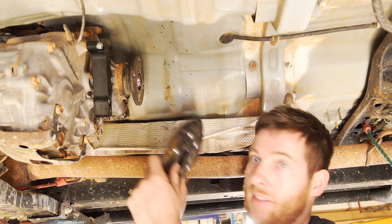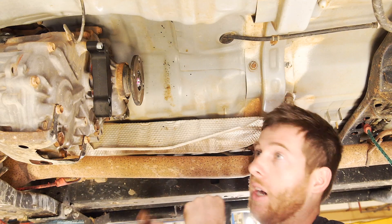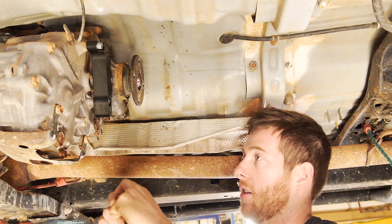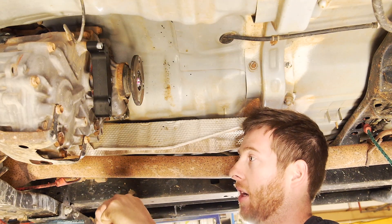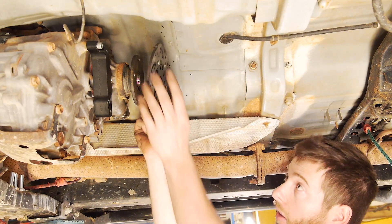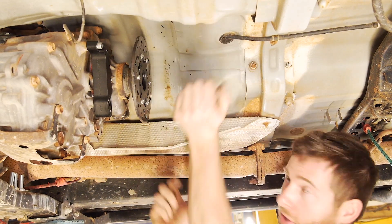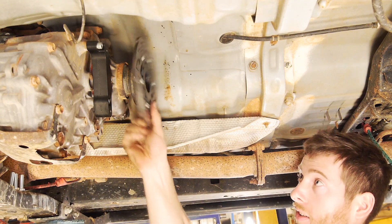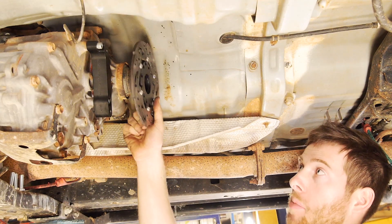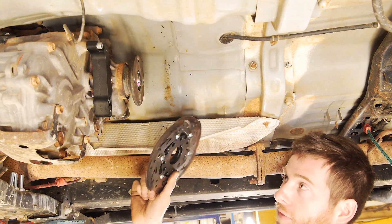So the next thing is to get the disc and the tail shaft mounted back up. You'll need your four bolts — these are M10 with the cone lock nuts. Just get them kind of lined up. Firstly, just put your hub up and check that it fits. As you can see, that tolerance is bloody perfect — it will literally stay there. It's a perfect fit, so there will be no balance issues or anything. And find out the right PCD — it should be the bigger one.